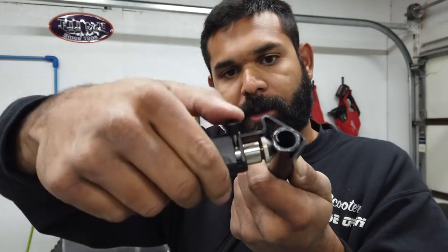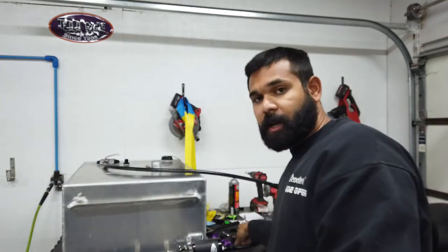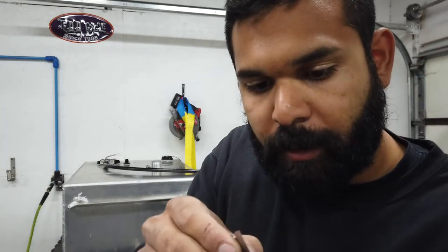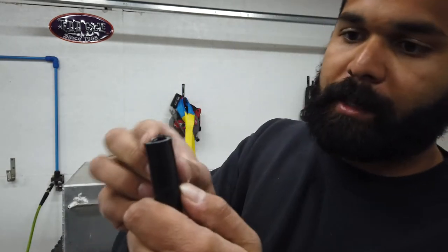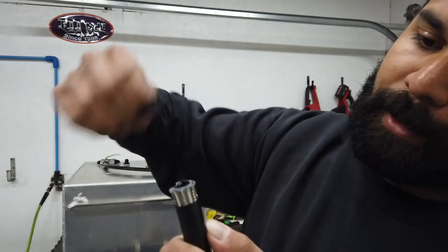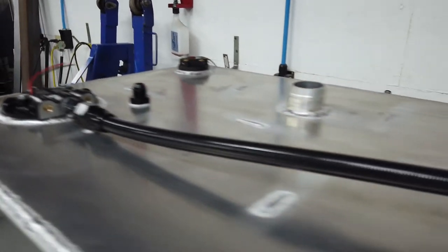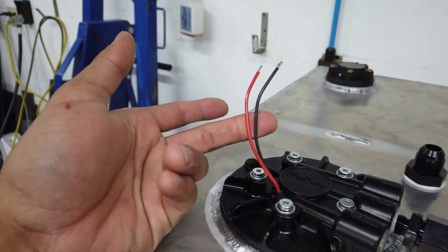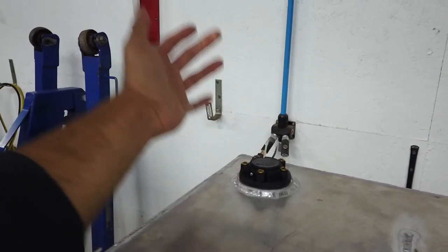Now on a battery cable, you turn this lever, it turns the blade 90 and scores it straight out, but I found it's not quite cutting it, so I just take a razor blade after to finish that part of it. Actually, I should probably get that pried open. That makes that whole working around with the razor thing a heck of a lot easier. Now that I've got some line attached, I'm going to make up some whips for the fuel pump and the sending unit. So when I go to put this thing in, they hang down nicely and I can just plug them in without struggling.